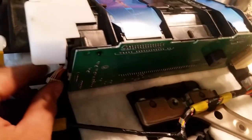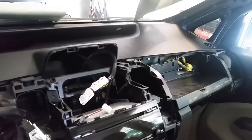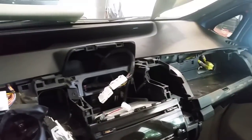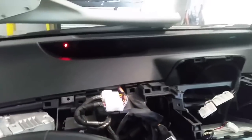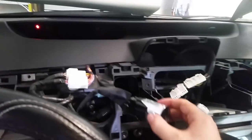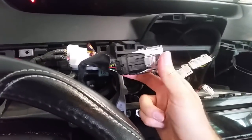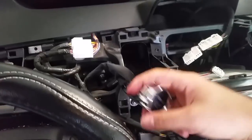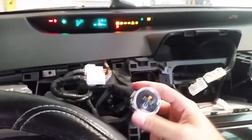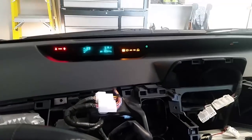I'll reassemble this in reverse order. Got one plug down here, these ribbon tape strips. The dash is back in. Make sure you hook up the SRS connector for the airbag. And then as a test fit, you'll plug these back in — that's for your instrument cluster and all your dash lights. You can actually just pull this power button switch right off the plastic, plug it in. Same thing with your park switch, so you can at least have park and start. Put on the brake. Batteries plugged back in. There went the plastic, but hey, we got dash lights again.